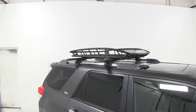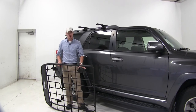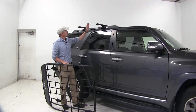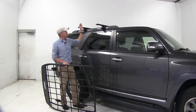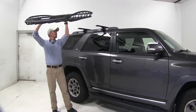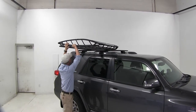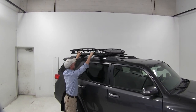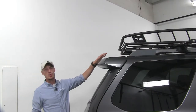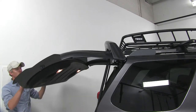It's very easy to get installed. We've already got our four mounting plates installed and measured out to match our crossbars. You also need to be sure you have a minimum distance between your crossbars of 20 inches. When positioning it on your roof rack system, you'll want to be sure the fairing is facing forward, and leave just enough room so you can open up your rear hatch.